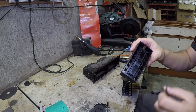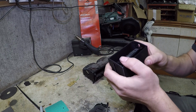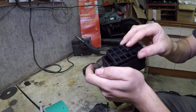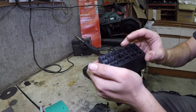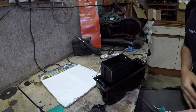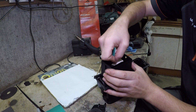And the adapter plate is designed, because on the cup holder is a little bridge, to glue it on there. You want to put that on there, glue that in place, that gives you a flat surface to glue to, and then you'd glue your vent in. So we'll glue that one in a minute. So just out of precaution, I'm going to scuff up the plastic parts, just to make sure they adhere to the glue better.